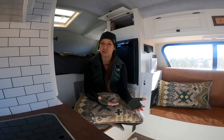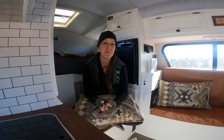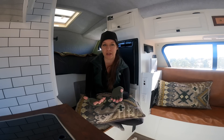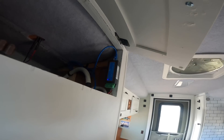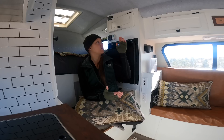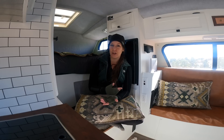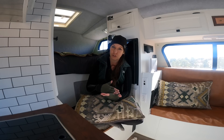Think about whether you want to switch your inverter on and off as needed, or keep it running all the time — for example, if you have a larger rig with a residential fridge, it's always going to run off an AC outlet. Now that we have a way to charge, hold, and use battery power, you need a way to monitor all of this. That's done through a battery monitor. There is a shunt attached to the actual electrical wiring, and the battery monitor reads off that — telling you battery percentage, voltage, how much power is coming in, etc. The Victron app via Bluetooth lets you monitor the solar controller, battery monitor, and control the inverter charger from your phone.